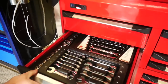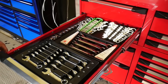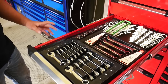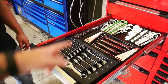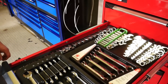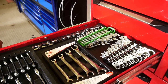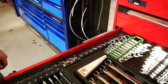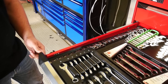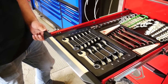Next drawer is another wrench drawer. Toolbox manufacturers should think about how many wrenches a technician actually has — three or four drawers worth. We need more full-size drawers for technicians. These include mid-length ratcheting ones, stubby ones, standard nut drivers, and more crow's feet. Line wrench clip crow's feet are really nice for those hard-to-get brake lines and fuel line fittings.